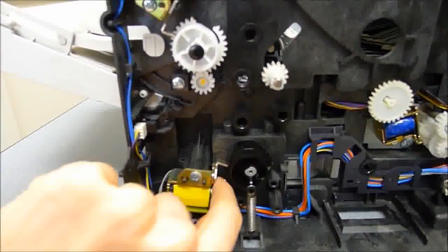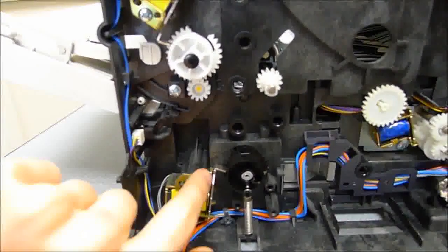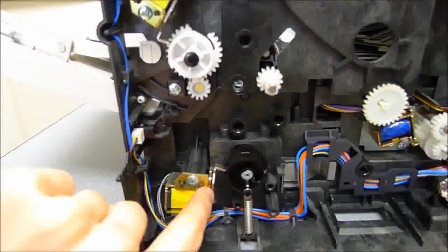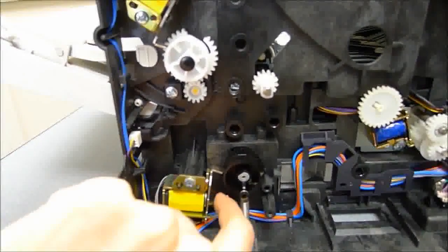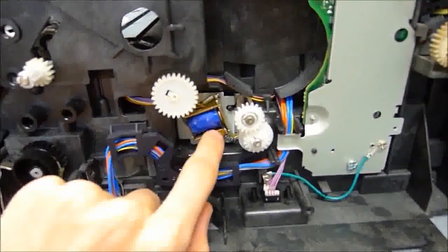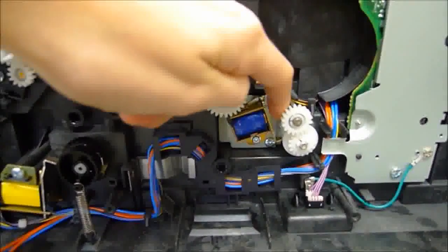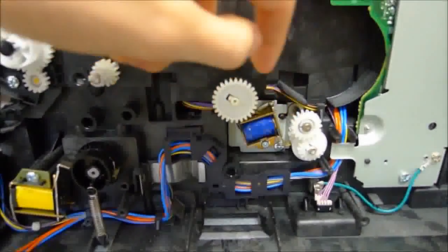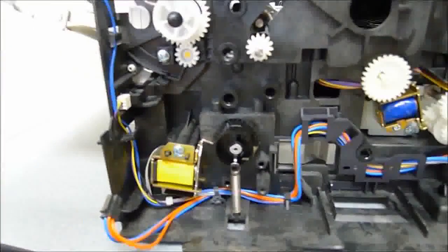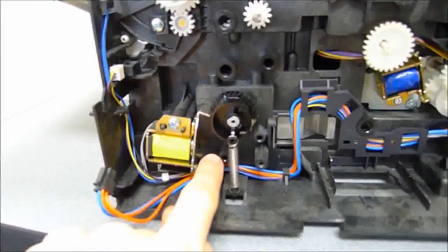These gears get held back and forth by solenoids, which are little magnets down here. Now originally when HP sells these, there's a little tiny bumper that basically prevents noise. But over the years that bumper gets worn down, and then all that's left stuck on the metal is just the adhesive that originally held the bumper in place. What happens is that the adhesive causes this little metal armature to stick in place, and because printers depend on millisecond or less time differences, obviously everything goes downhill from there.